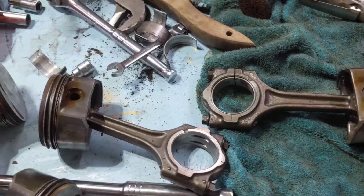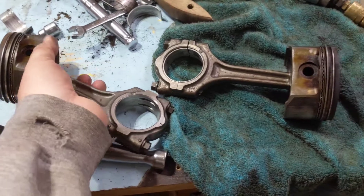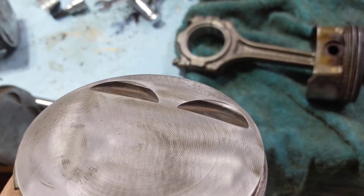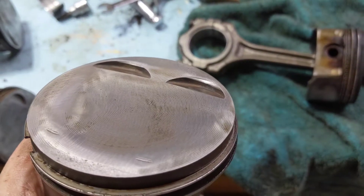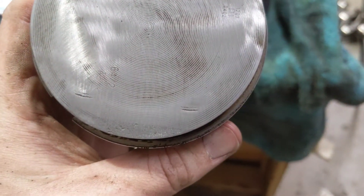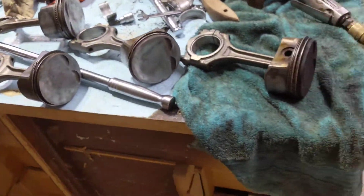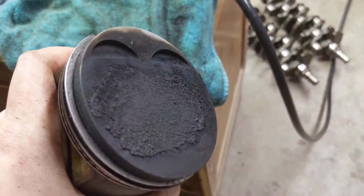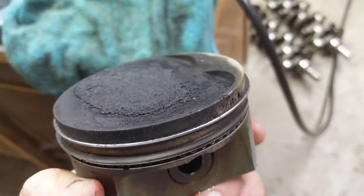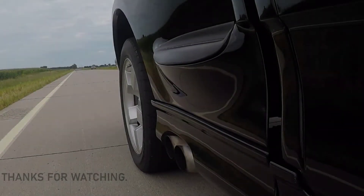You can see these two kiss marks — that would have been piston-to-valve contact at some point. One of these pistons had a mark where it actually came into contact on the valve relief side too, which must have been a timing issue. You can see on the top of that valve relief how it's kind of pulled back — there was a sharp burr there that I evened out with a utility knife and blended down. That's probably the best it's going to get for this engine — it's just caked on there and I'm not really sure what caused it, possibly oil.